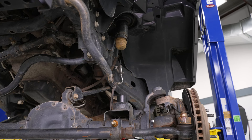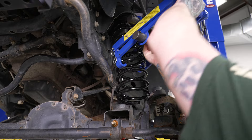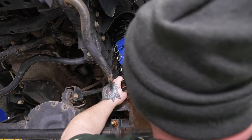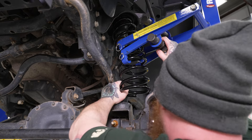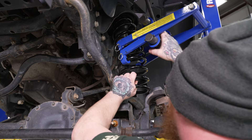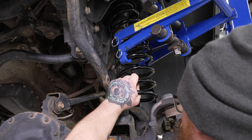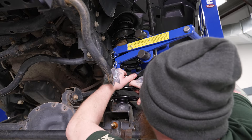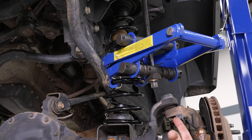Now it's time to get our new spring into position. We've got our differential lowered down a good amount, and we're also using a handheld spring compressor, which is going to make our job a little easier. We'll go ahead and slide that up, get it in position, and work our spring over top of our new spacer. Then drop it down a hair and let that come right back down. Then we can release the tension on our spring compressor. These handheld style spring compressors come in many different forms and are usually free to rent from any auto parts store.